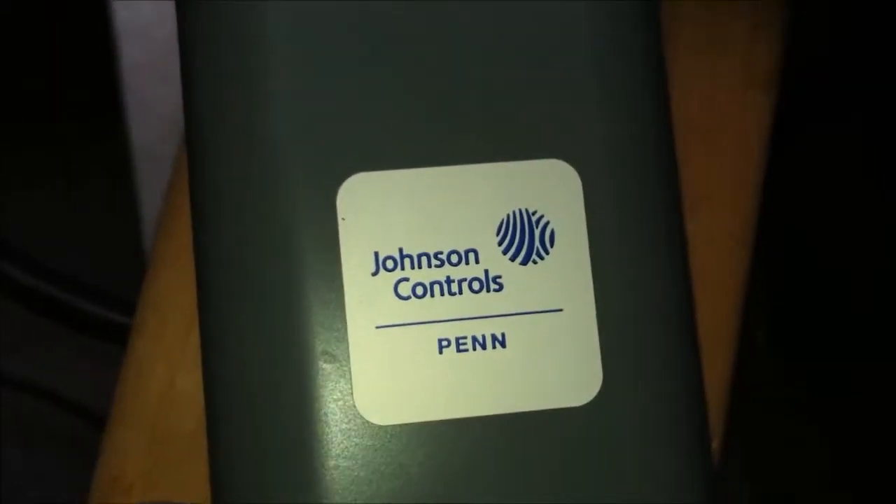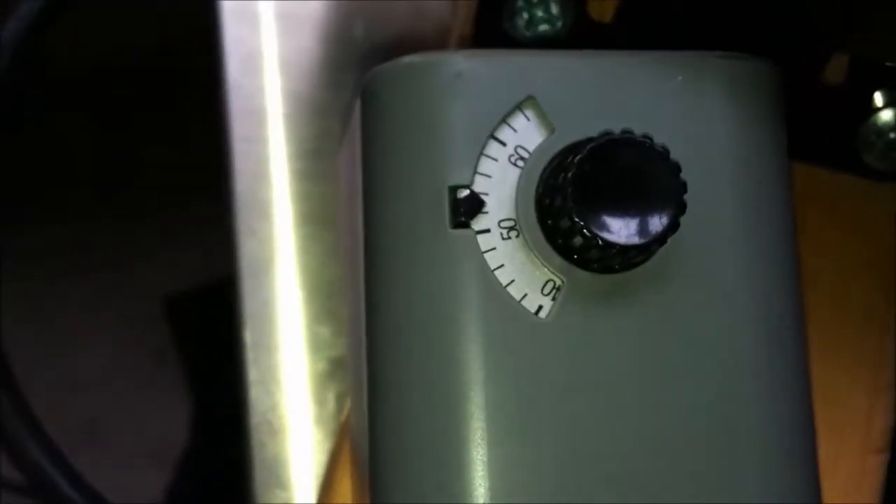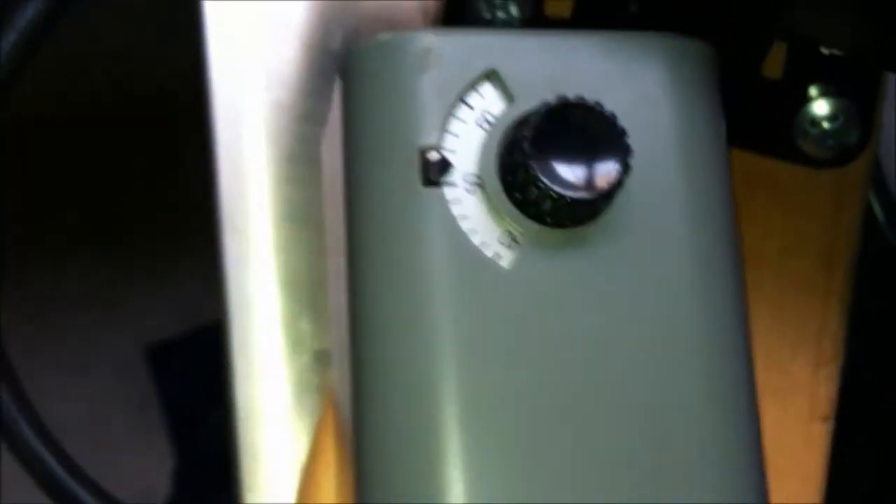You're probably wondering how I monitor that — I've posted about it before in other videos. I use a temperature probe in a beer bottle down there. The probe connects to my Johnson Controls unit, which you can dial in to whatever temperature you want, as accurately as you need. You just plug the freezer cord into the temperature controlling unit and it runs automatically.